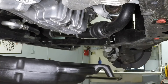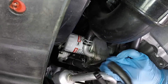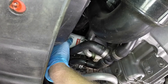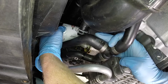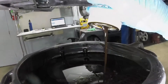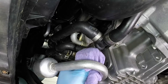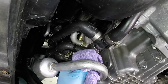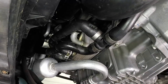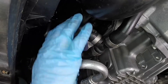Position the drain pan underneath the oil filter. Move the hoses aside, then loosen the oil filter by turning it counter-clockwise with a filter wrench. Once the filter is loose, use your hands to unscrew it from the block. Empty out the oil from the old filter into the drain pan. Using a clean rag saturated in brake cleaner, wipe off the filter mounting surface on the block and also the surrounding hoses. Make sure that none of the old gasket remains stuck to the block mounting surface. It can be removed with a scraper if necessary.